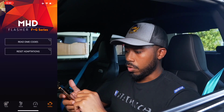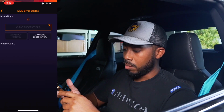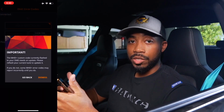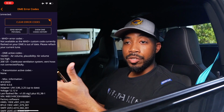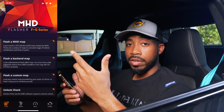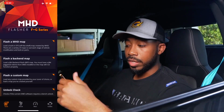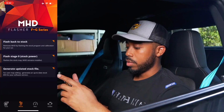For us, we're just going to go ahead and read any DME codes that we have and clear them just to see if anything pops up. Now, right now it's saying that I need to do an update, so I'm going to go ahead and dismiss it. So after you register your license to the app, you're going to go ahead and do a scan just to make sure there aren't any previous error codes that you need to clear. Once that is done, we're going to go ahead and clear any codes. It doesn't seem that I have any.